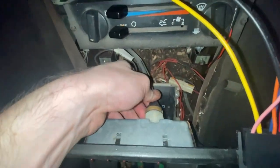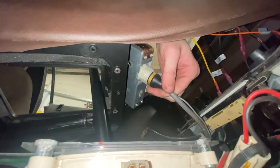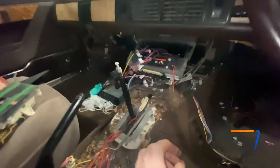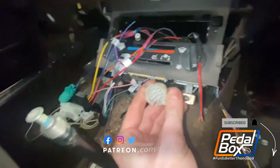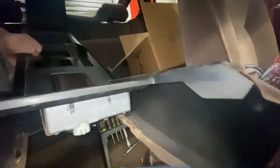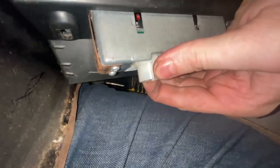Just going to see if I can find an easy release for the trip computer wiring connector. Good news — it turns out that clip is really easy to remove. The wiring connector sits this way up in the back of the unit, and these little slots in the top and bottom interface with little clips on the top and bottom of the connector. So all you've got to do is get a hand in over the top, press in there, and the whole connector comes off. Really, really easy — an absolute piece of cake.